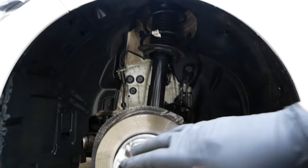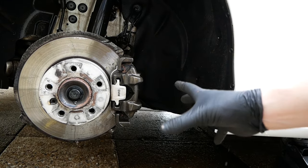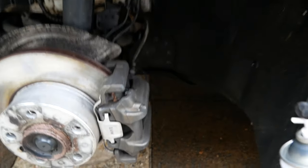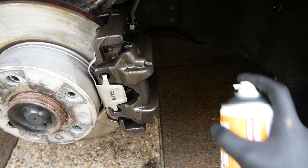I'm fully aware there are other methods of doing this, but the kit I've got is a paint-on while it's still on the car, so you just have to be really accurate. I'll sand it all down, wire brush it, then mask it all off. Once it's been washed out I'm going to jet wash the whole wheel arch and then spray it down. I've sanded most of it down and jet washed inside the wheel arch. I'll let that dry, put a bit more brake cleaner on there, and then it'll be ready for the first coat of paint.